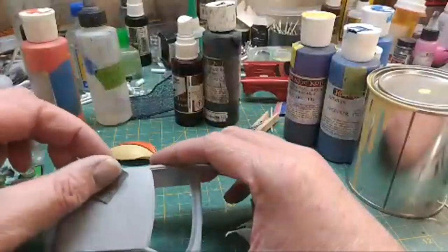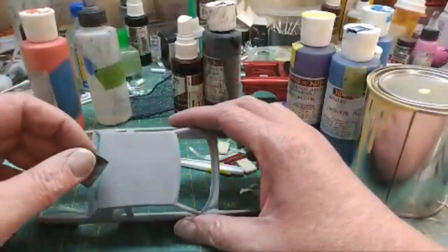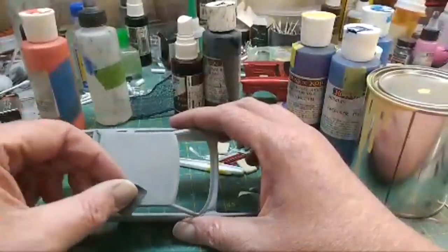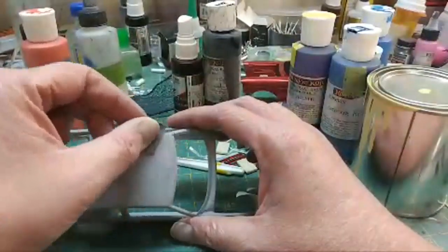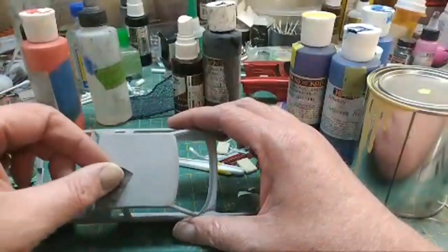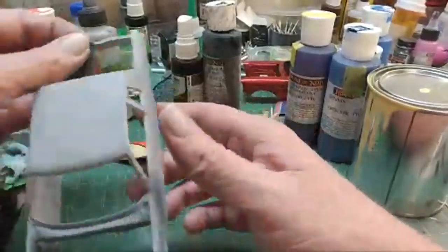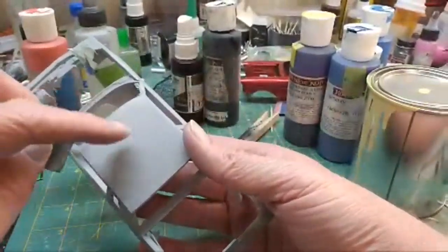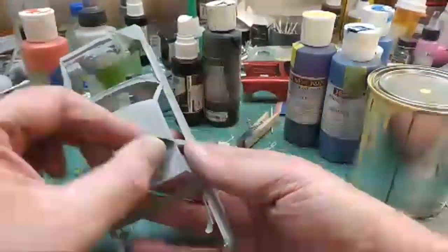I got everything prepped except the body of this and the hood of the Pete. So I wanted to show you guys how to do this with the high build good primer. You just kind of softly go back and forth with the high build primer and a cross hatch. Now this is 800 grit. You need something that's going to be... see, there's a couple indents in there with the scratches with the sandpaper.